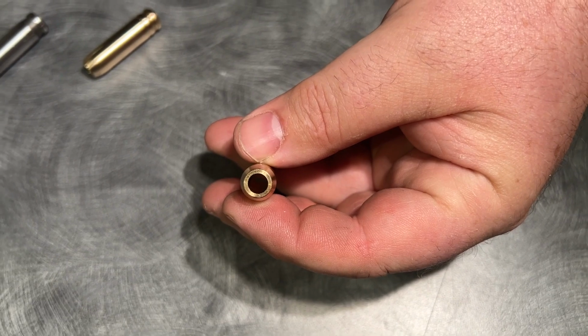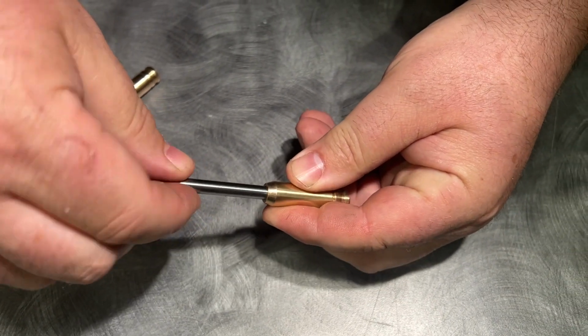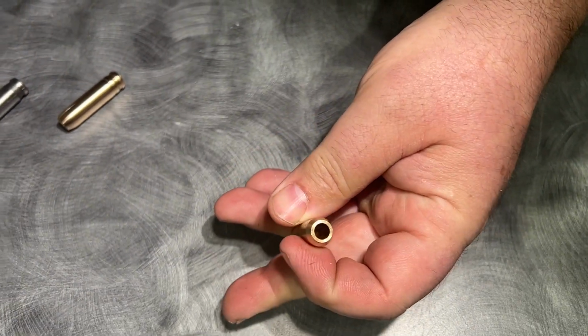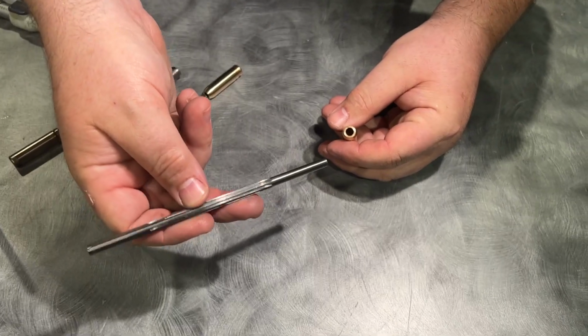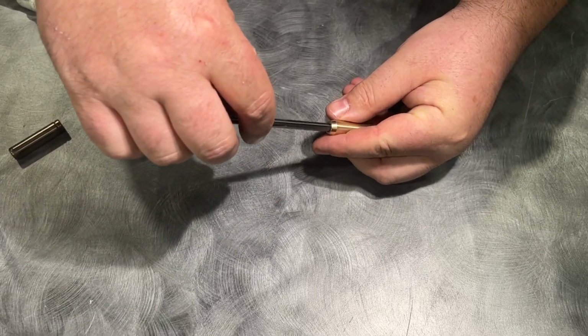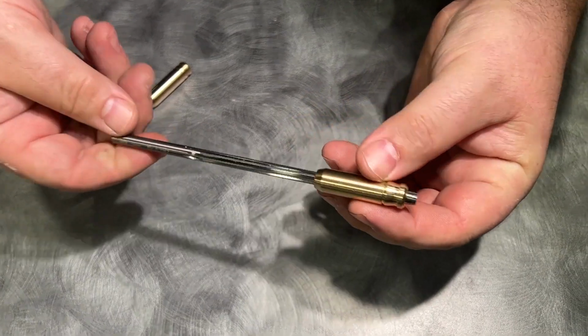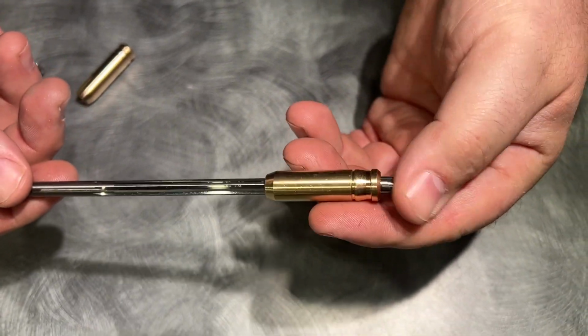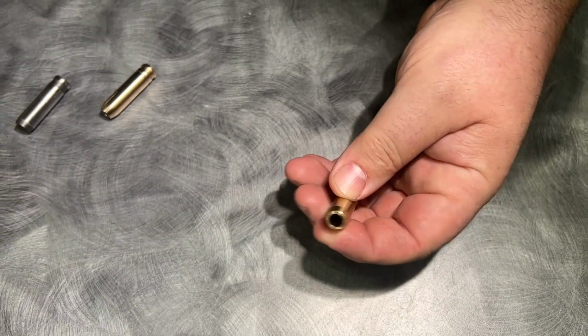Now, what somebody might do is take a valve and try to stick it in there and see, does it fit? Well, the inner diameter actually needs to be machined. You machine that with a reamer. A reamer or a hone, we can use both. You put the reamer in there, see how it's a piloted reamer. So now the thing is all the way through, so it goes straight, and they would size that.